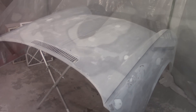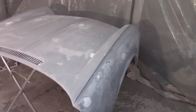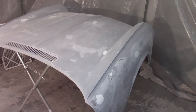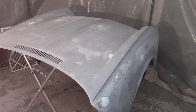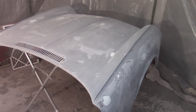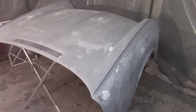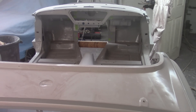I'm hoping the build primer will help me out there. The bonnet has been sanded down with 150, 220, and red scuff pad — it's still really dirty and dusty. I'm not going to waste the wax and grease remover on it now because I'd just hit it again anyway. Given the temperature requirements, and I can't tell you how tempting it is to bite the bullet on two degrees of paint temperature, but I'm just not going to do it. She's ready for epoxy primer, so I'll see if I can sneak over here sometime this week and get two coats on real quick, but I might have to wait till the weekend.